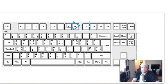Tap, tap, tap repeatedly as it boots. If it goes to the login screen, you'll know it didn't work. Next time, turn it on and maybe hold down the F9 key — just hold it down and see if that catches.